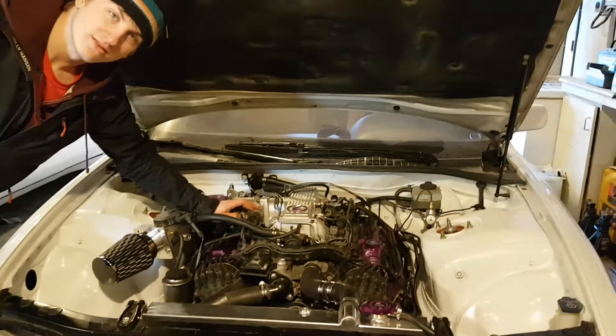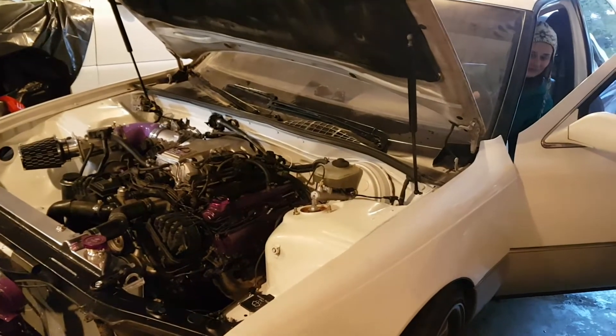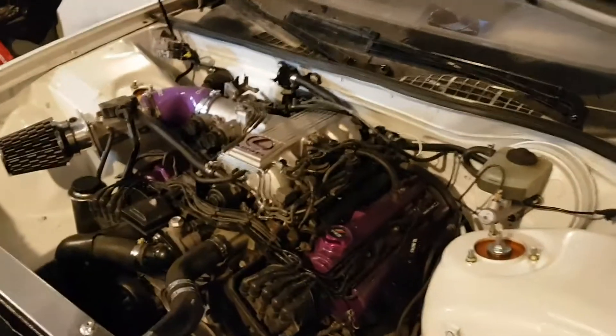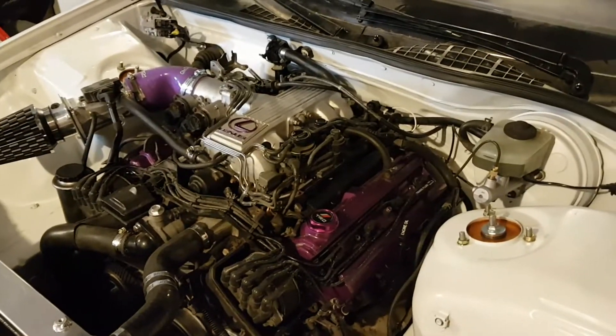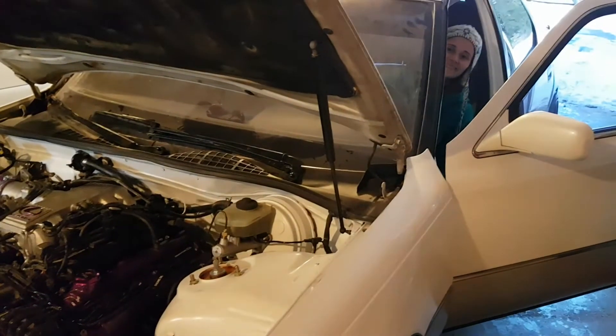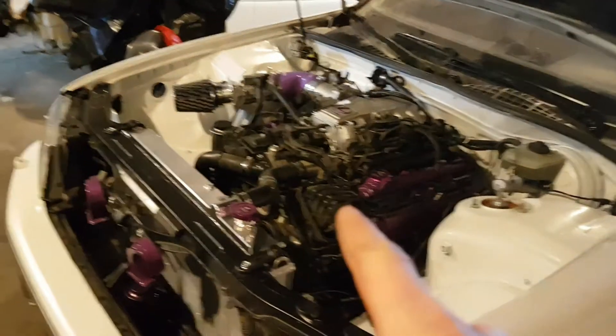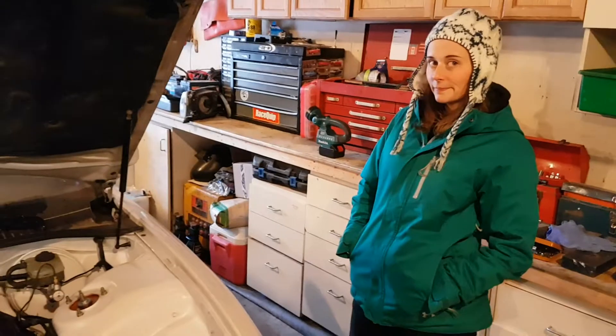So we start it off to show the people. As you can see, it's still a rough idle. It does almost die sometimes — and it just died. Start it up once more. It was just running perfectly fine, so we still have a bit of digging to do. The cats sometimes glow bright red, which makes me think it's running too rich — too much fuel, which is why it almost dies, and the excess fuel gets burned up in the cats. If we could figure that out, I think it would idle well all the time.